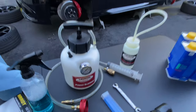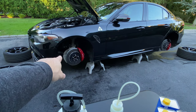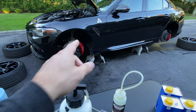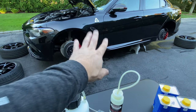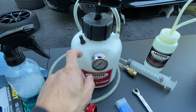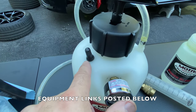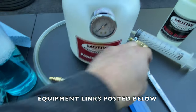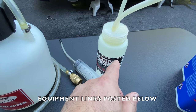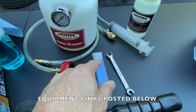We're all finished with the full flush and bleed on the Alfa Romeo Giulia Quadrifoglio — very, very easy process. A couple of tips: if you notice any corrosion on your bleeder screws, order new ones ahead of time. I ran into an issue on the passenger side front where it was seized with a lot of rust. Definitely better to remove the fluid after a couple of years. Recommend getting a power bleeder — they're inexpensive. If you're on a newer car without a diagnostic tool to open and close the ABS spool valve, just change your gauge, install a Schrader valve, get the billet adapter and quick disconnects, an 11 millimeter line wrench, a syringe, a reservoir, a rubber mallet, and the touch-up paint easy dabbers to clean out fluid that sits inside the brake bleeders.